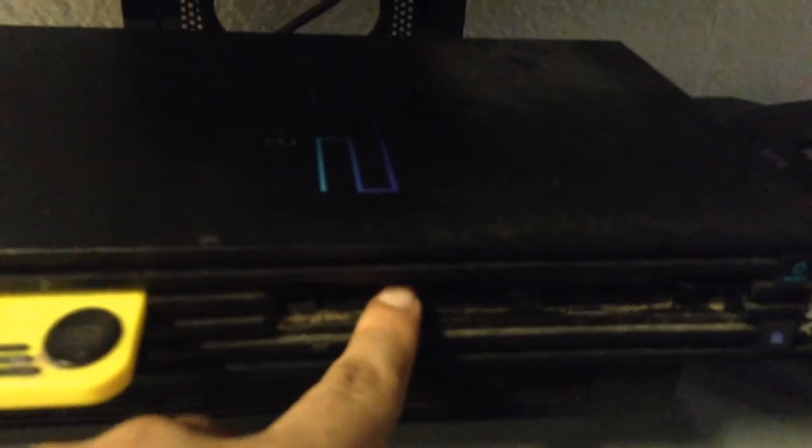In order to use any of this, because the PS2 is region locked, you're gonna have to do a few things with your PS2. It's really easy if you have the fat one. You're gonna need this slide tool to basically open the disc tray. You need to pop off or unscrew — depending what model of the fat PS2 you have — the little front cover of the disc tray that has the PS logo on it.